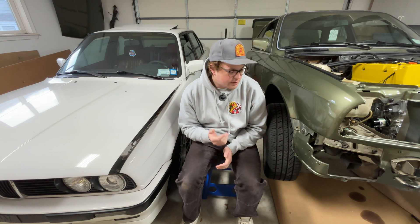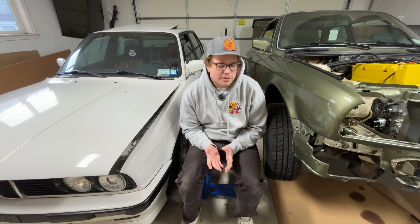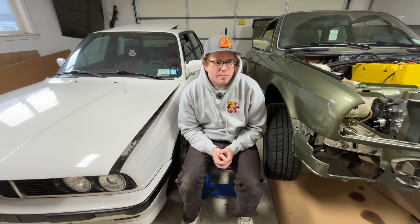Last video the car starts — you can turn it on, very cool — but I was getting an error on the ECU saying there's a crank sensor signal problem. I was troubleshooting that, testing the voltage on the wire, everything seemed good. A lot of back and forth trying to figure it out, and then I was checking the actual pinout on the ECU to see if the crank sensor was going to the correct pin. I found it was going to pin 20 and it should have been on pin 7, which seemed wrong.